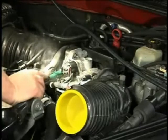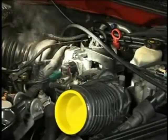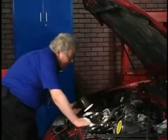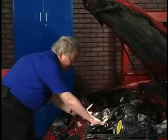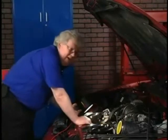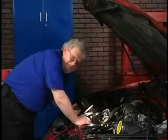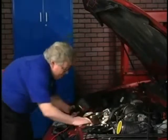That's definitely got to be fixed before this car leaves the bay. And we've got some other sources of leaks. I see a little bit of smoke — there's an oil leak. Now, how do we get smoke in the oil? I'm putting smoke in the intake manifold. What's in common between the crankcase and the intake manifold? The PCV system. We're rolling smoke through the PCV system and it's coming out the oil filler cap.